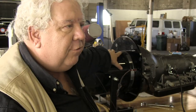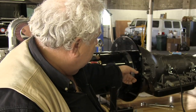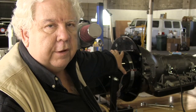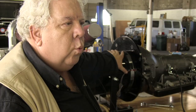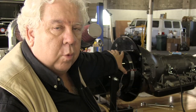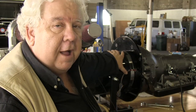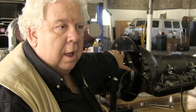We checked that with an oscilloscope, by putting the magnets on a drill and turning them and holding this device here. This is a 3-wire device. It takes 12 volts and ground and outputs a pulse when the signal passes. As it's an NPN open collector device, it would normally use about a 2.5 kilo ohm pull-up resistor between the 12 volts and the signal out. You can run it from 5 volts just as well, and it takes a 1K pull-up resistor to the 5 volt supply to do the same thing, and it makes a nice pulse each time it passes one of those magnets.